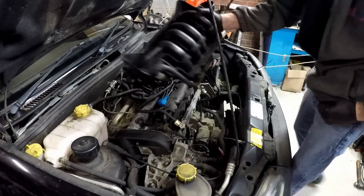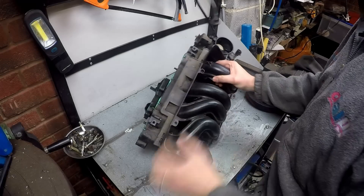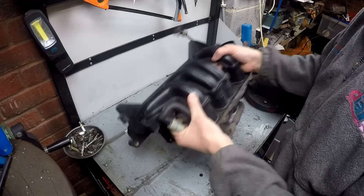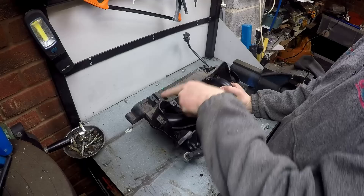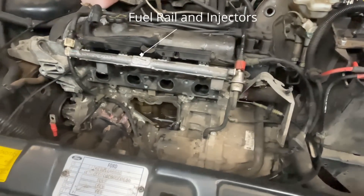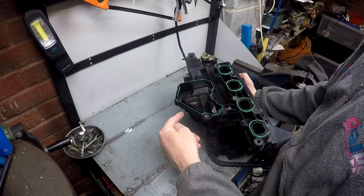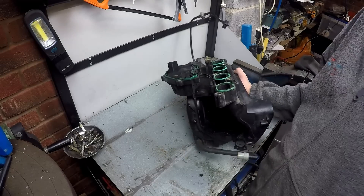The original manifold is made out of nylon six with glass fibre reinforcement, which is fairly common, but it is very heavy — a lot of material and very stiff. Straight away we can see the injectors are held in the head, which is good because that means it's one less thing to model. However, the crankcase breather is built into the inlet manifold, so that's going to have to be modelled up and printed as a separate item.